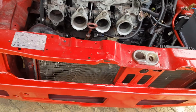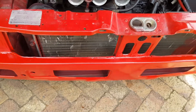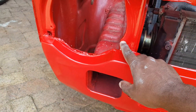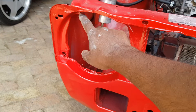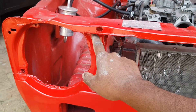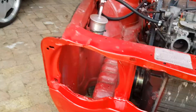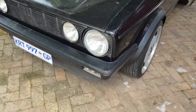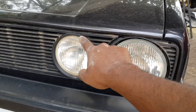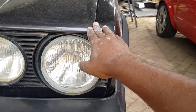I'm going to have to make special brackets for the grill to fit, but the majority should be easy — that shouldn't be an issue. The last thing you'll need to do concerns the original mounting spots for your lights. The lights will now move up because your grill is moving up, so you'll need to make new holes for your lights. I've noticed some guys actually drop the bonnet down to close the gap — it'll line up nicely along the top, but then you'll see a big gap and your bonnet and fender won't line up.